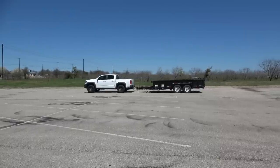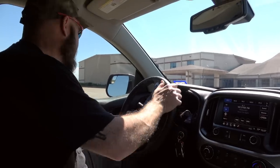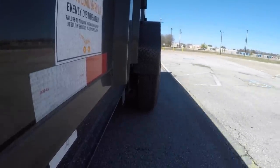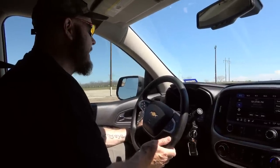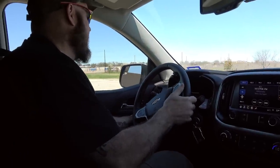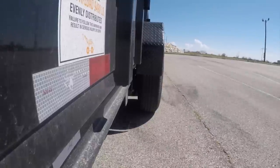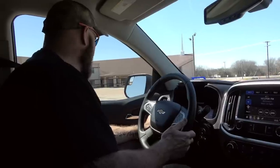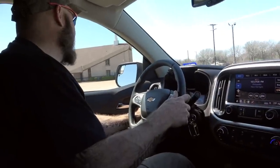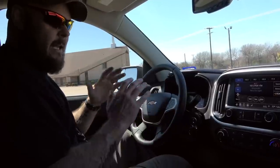It's pretty close — we're going to add one more, so we're now at 4.0. We're only using the trailer brakes, not the vehicle brakes. At 4.0 the tires actually locked up, so we're going to back it off to 3.5. It's super important to get this set up properly because if you're going down the road and you start getting trailer sway, the way you get it under control is by applying the trailer brakes only. Right there at 3.5 the trailer brakes stopped the entire rig without sliding, giving you the maximum amount of control.